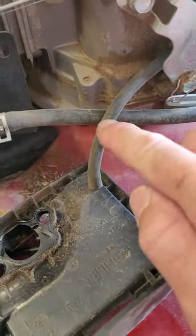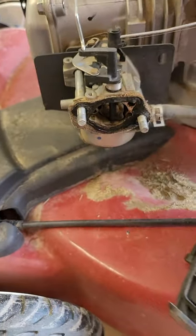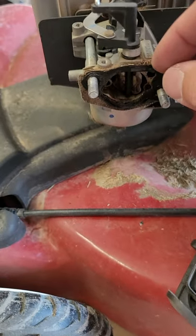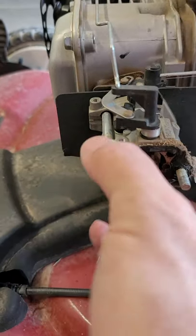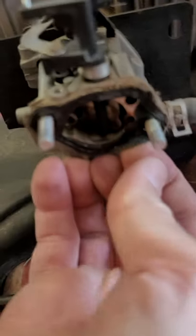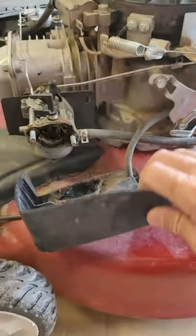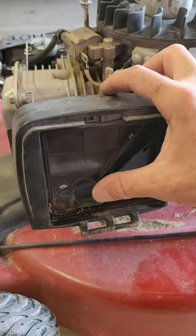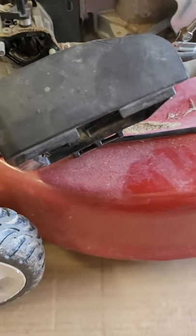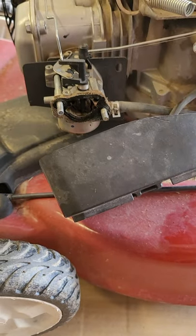Two more 10mm nuts. You're going to want to pull whichever way is easiest. This hose is just going to come right off the engine — which definitely makes me feel like that's just a crankcase breather port. And then here is the vent for the fuel tank, and this is the fuel line coming from the fuel tank. There is a gasket that should be present between this and the carb, and you can see it — it's peeling up. I'm going to order a kit — a whole new kit that comes with a new piece that has that air director on there. I feel like something's going on with it being missing that is causing this to get superheated. I'll put the part number for that kit in the description; I've seen them on eBay for $15–$16.